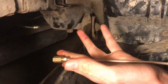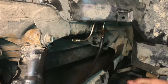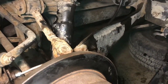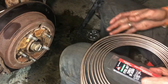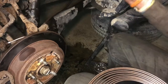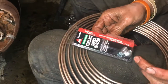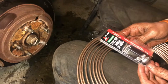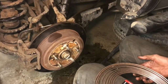We can go ahead and put this together, make sure everything is nice and tight, then hook the hose up. I have all the brake lines installed and bent, the hardware is hooked up, we pumped the brake, it built pressure, and it doesn't leak anywhere — so this system is ready to go. It's much cheaper to get brake line online and build it yourself. You need the brake line, the correct fittings, and a double flaring tool — that's it. You can bend nickel copper with your hand. I hope you found this video useful — don't forget to like and subscribe.